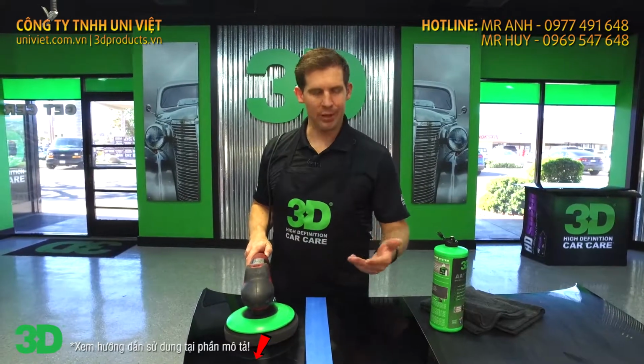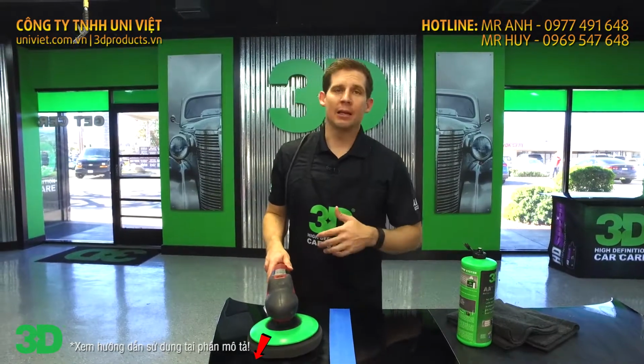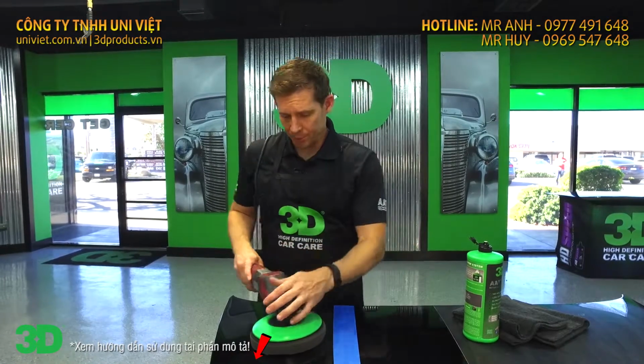You can go 900, 1,200, anywhere around there. No big deal. You can go a little higher if you want to, but again, that's personal preference. We just prefer you be around 1,100 to keep the heat down, have a little bit more control, create a little bit more longevity in the polish. So we're going to turn this on.